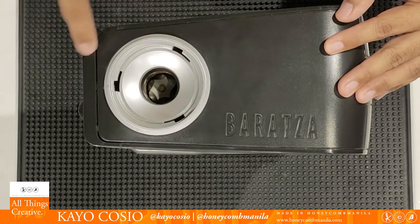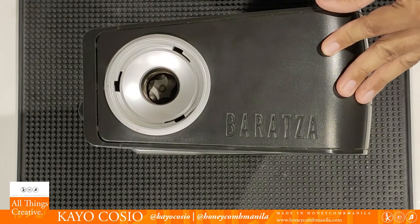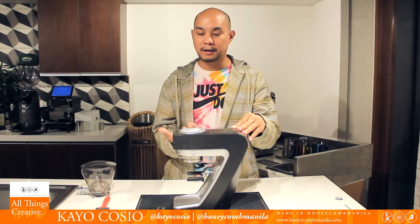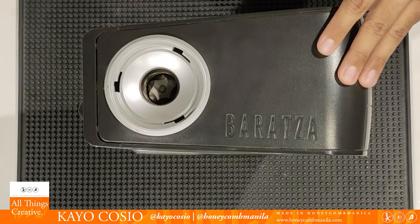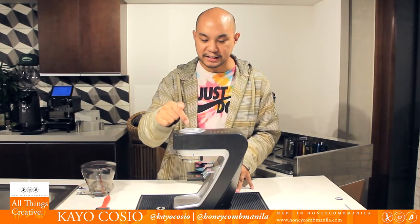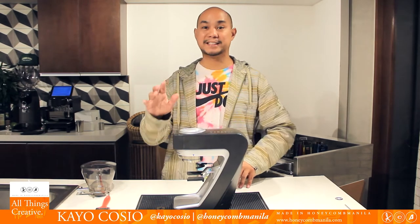So there's a drive system that spins that outside burr, and the result is that there's more surface area pulling the coffee through the grinder. That's giving you a faster grind speed, just that little change of which section is doing the motion changes the grind profile drastically.